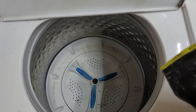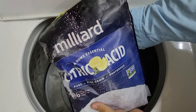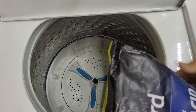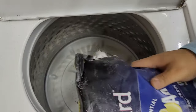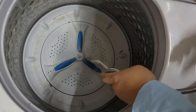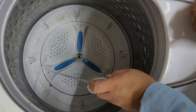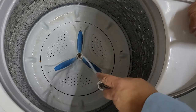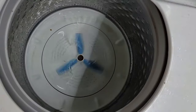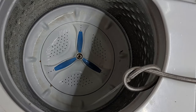Next I'm going to try to clean and strip away the gunk underneath the plate using citric acid. This stuff is the best, cheapest thing we've come across to clean washers. I'm going to put about one to one-and-a-half cups in this washer. When we add hot water to it, it will loosen up whatever is keeping the plate stuck — or we hope so. Once you have the citric acid in the tub, you can either set the machine on a wash cycle and let it run a pretend load of clothes, or fill the tub with hot water.